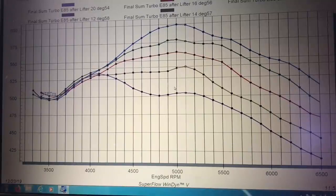Down to 561 at 16 degrees, down to 541 at 14 degrees, and then finally down near 500 foot-pounds at 12 degrees. This is the area where you would change the timing at the torque peak, especially with pump gas. You would want to minimize the timing in this area because the cylinder pressure is going to be really high — this is where you're going to get detonation. With pump gas, you could probably add some timing out at the top because it'll tolerate it, but not here in this area. You want less timing here, and if you're able to run boost in this low RPM range, you'll also want less timing there.